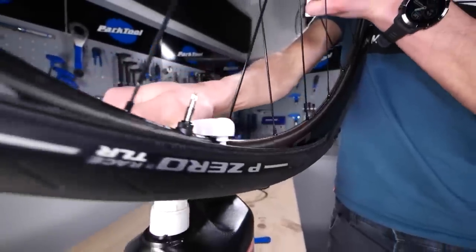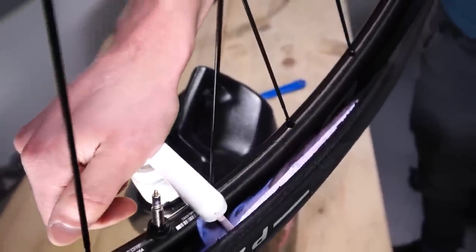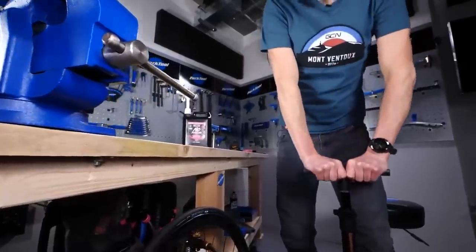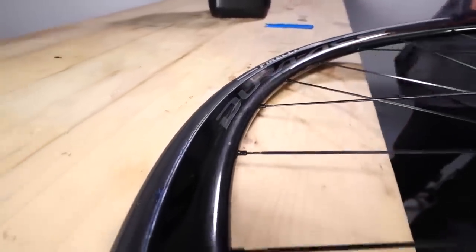As we all know, I love tubeless, so I think it'd be a no-brainer to opt for tubeless. I do agree that running a latex tube on carbon rims with rim brakes in heavy braking conditions can lead to some problems. Personally I've never experienced any of those problems, but it's always better to err on the side of caution — you don't want blowouts on fast descents. Best option: if you've got tubeless compatible rims, go tubeless for low rolling resistance. You could also run an insert if you're worried about punctures, but I don't think that's required.